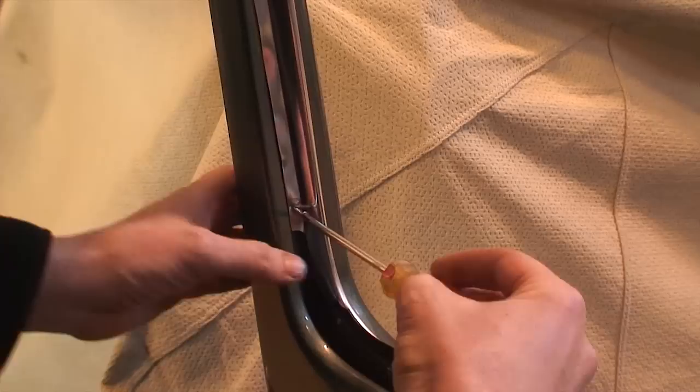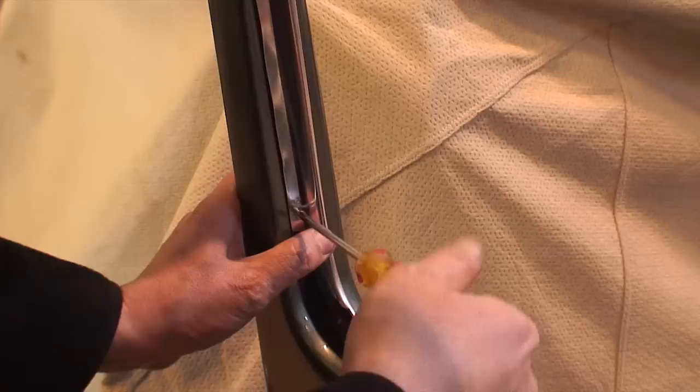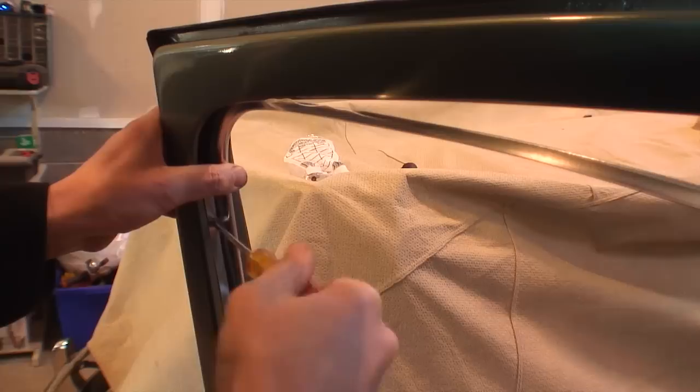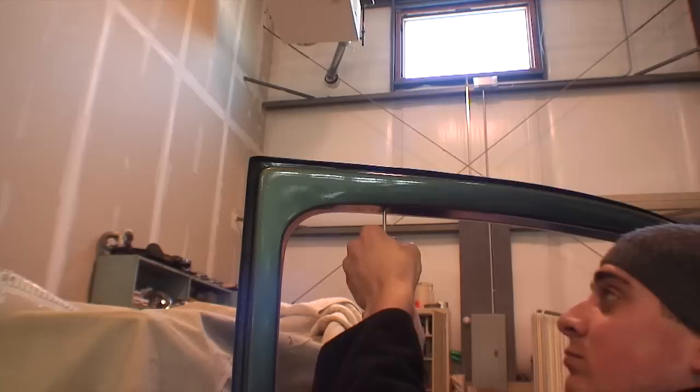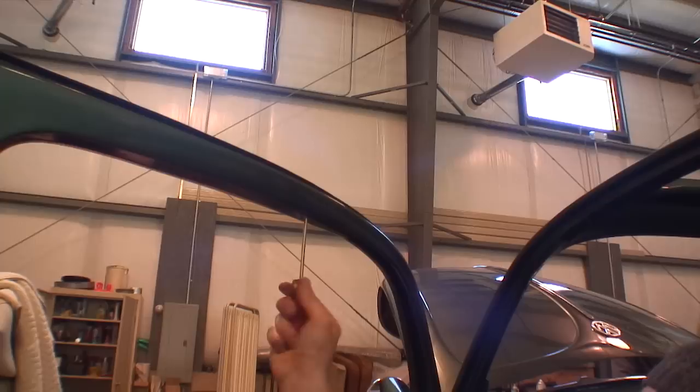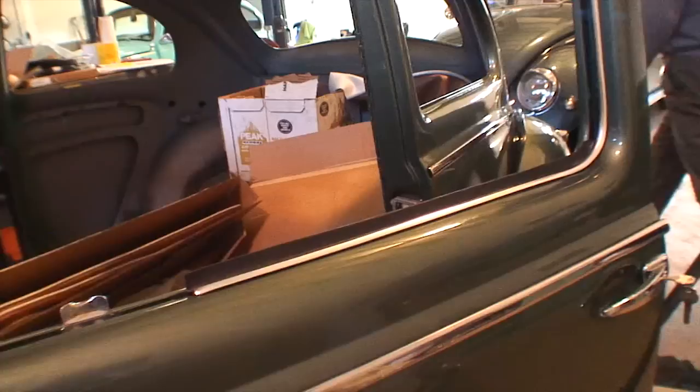Right there on the tab — the flat part of the chrome — that's what rests flush inside the door. The rounded part of the chrome sits on the outside, like the outer edge of the door. So I found my hole and I'm going to start putting my machine screws in. Take your time with this, there shouldn't be any forcing. Those go in pretty easily. If you can't find the holes or your holes are frozen or filled in, you can always use self-tapper screws. Getting it in the top as well — just punch a hole through the aluminum. It's only an aluminum scraper, so it's pretty easy to punch a hole through it.